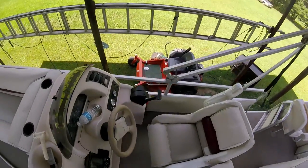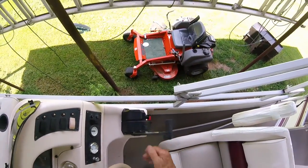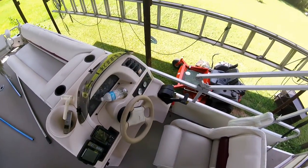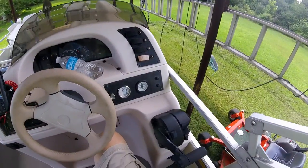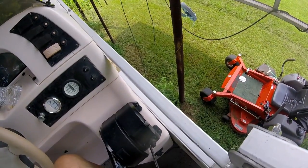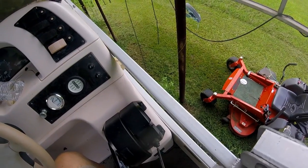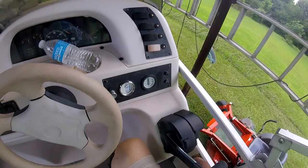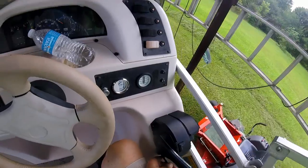But open like this in the weather is why my ignition key got so much moisture and rain inside there. I'm almost sure it's going to solve some of my problems just replacing it, but first I've got to be able to get it off there. Alright, we'll begin by taking these four screws out again. Somehow I've got to figure a way to hold the ignition switch from turning while I loosen the nut. The whole switch is turning. And you can't lift a handle to get your hand underneath there. Maybe I can stretch it. Don't know.